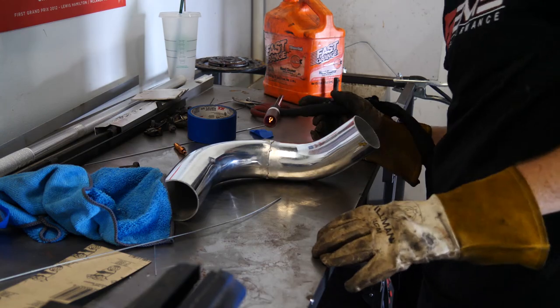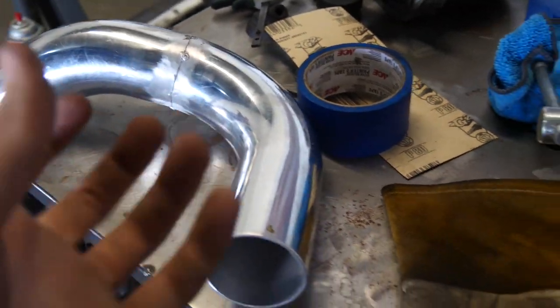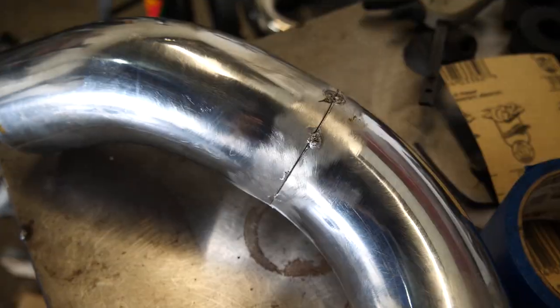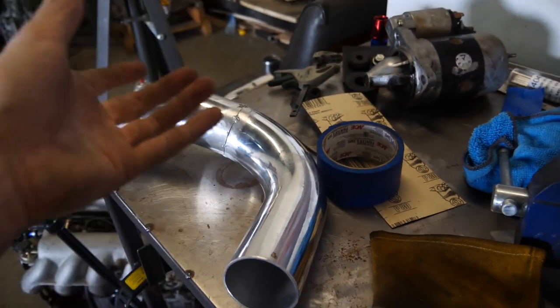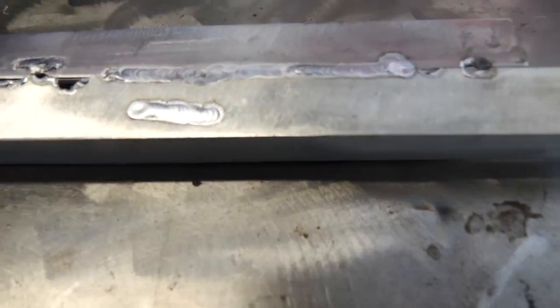It's going. It's welding. There's something up with this aluminum. I don't know what it is. It might not be clean enough, but I just couldn't get a clean weld pool. It just kept kind of bubbling and corroding, it was terrible. I thought that something might've been wrong with my tungsten, but then I go onto this and lay a perfect dime. So something's up with this.